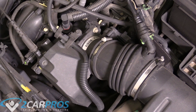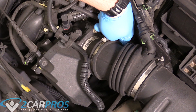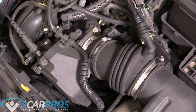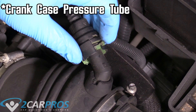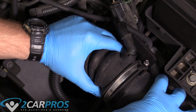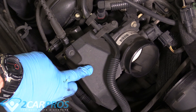The first thing I'm going to do — and you don't have to do this if you're following along at home — is remove the intake boot. I'm doing that because it's easier to get to the last bolt down here on the throttle body and easier to film. It's not 100% necessary. You'll need a 6mm socket to loosen the hose clamps for the boot. For the evap tube, grab the safety, push it over, and then remove. With those three things out of the way, we can remove the intake boot.